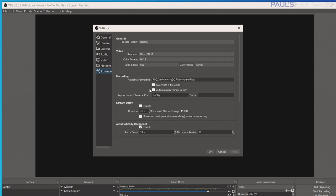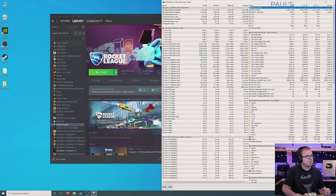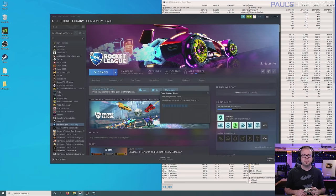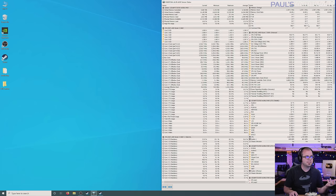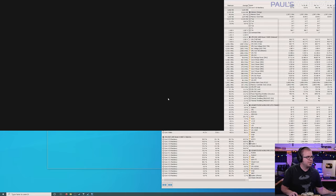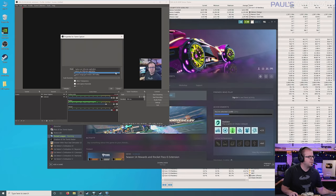There are a lot of tweaks and stuff you can do with different settings for OBS. This is a tutorial about setting up a computer and not necessarily about streaming, so I'm just going to go with this for now and switch my capture folder to one I made on the desktop. So Rocket League is ready to go, and I've loaded HWInfo 64 to keep an eye on things — especially these maximum value tabs. The thing I'm keeping the closest eye on is going to be the CPU temperature. I've also added an Xbox 360 controller because it's Rocket League and I have a better time with the controller. Rocket League has finished updating, and specifically I'm going to be monitoring the CPU temperature maximum as well as the frequencies we're running at.